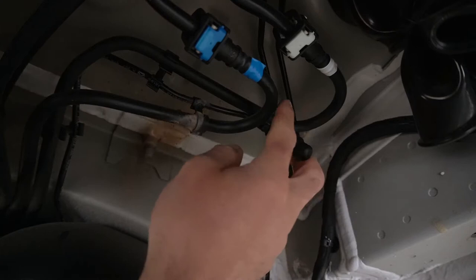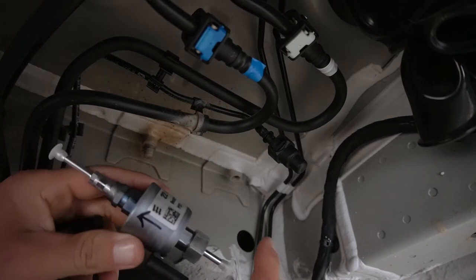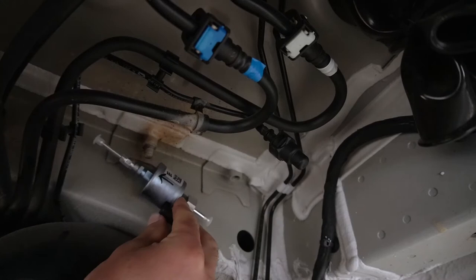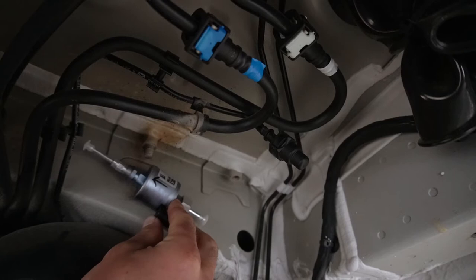So right here is the KL1 adapter where you will fit in. Like I told you, I was gonna put an arrow just to make sure that I ran the fuel the right way. So the fuel from the adapter will plug into here. I'm going to mount it right around in here so that I can come in and pop in, and then I'll run above the drive shaft, the exhaust manifold, and then up into the heater itself to give it fuel.